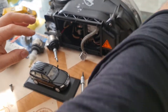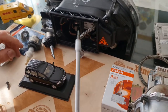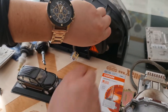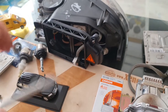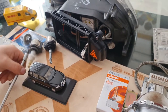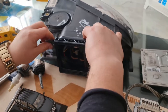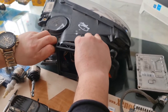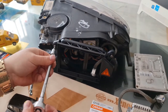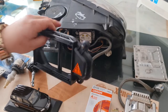If you don't have a low beam or high beam, it means that your ballast unit is faulty. By the way, you will need a Torx T20 to remove the ballast, the back cover, and everything on this headlight.